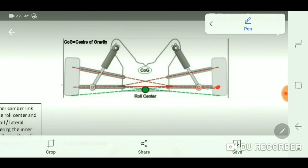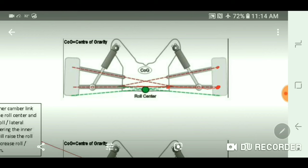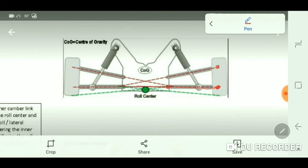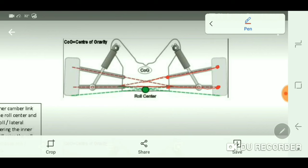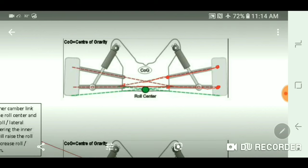Continue that line as far as you can go — that's represented by this dotted red line going across the bottom of the screen. The next line you draw from the right-hand side is from where your camber link attaches to the rear hub, and then the location that the rear camber link attaches to the rear shock tower. Draw a line through those dots and keep extending it — that's the other dotted red line. Where those two lines that you drew through your pivot points intersect is called your instant center.